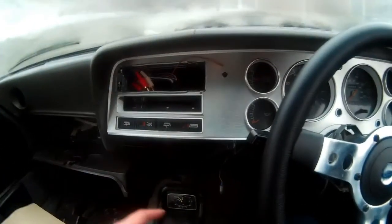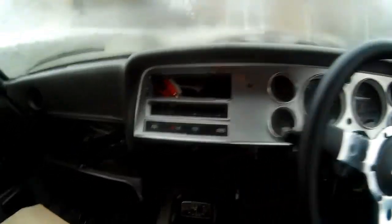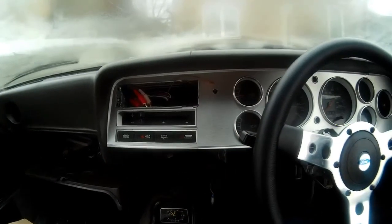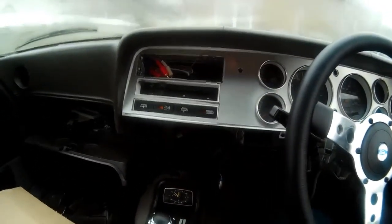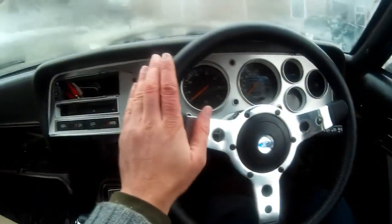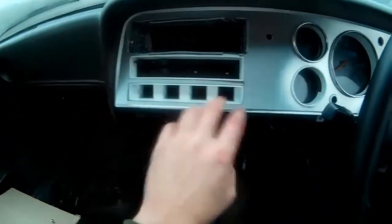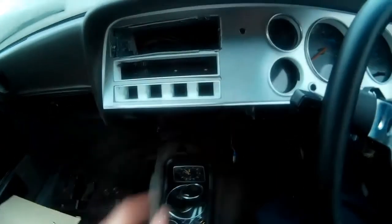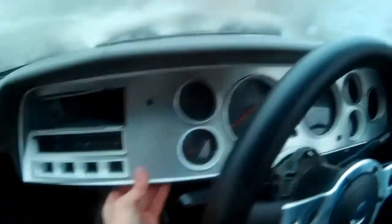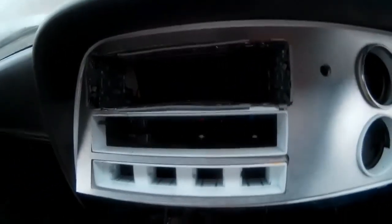After some jiggling around I've removed the stereo. I've also pulled off the dimmer switch, which just pulls straight off. Now I'm going to try removing the screws that hold on the instrument cluster to see if it will just pop off. I think I'll also need to take off the steering wheel and the glove box for ease of access. The instrument panel is halfway out — I've removed three screws from the bottom and the whole thing wobbles. The four switches here you just grab from behind, push forward so they pop out, then undo the plugs off the back. But there's something at the top holding it in that I can't quite figure out — I've read there are spring clips behind the dash but I can't find any.